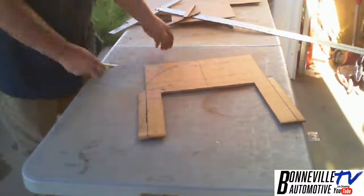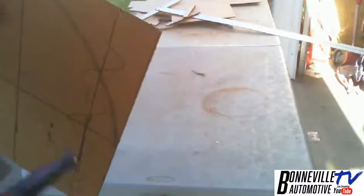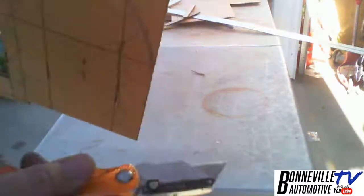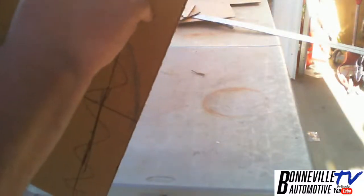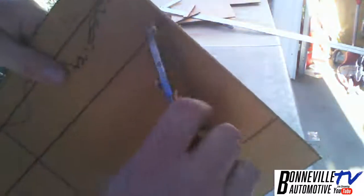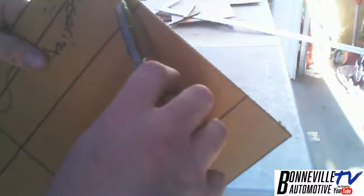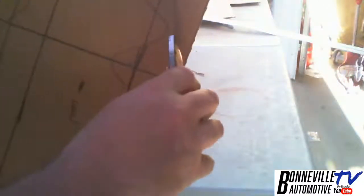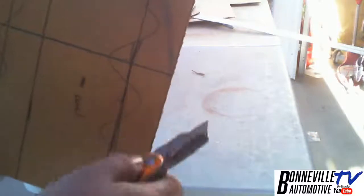And then I mentioned this before, but I want to bring over this again. So this is double corrugated cardboard. Came with the appliance. We ordered two different appliances to update the house. So I kept the cardboard. Great. But what you want to do is you don't want to start cutting here, because what will happen is it'll collapse the cardboard and you won't get a really good edge. So you want to start here and you work your way around. And then you start here and work your way this way. Learned this in doing theater design and stage work.